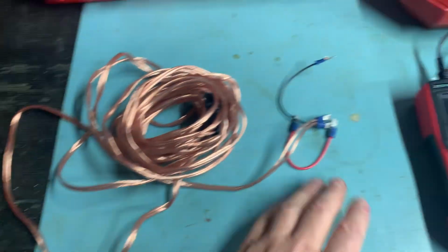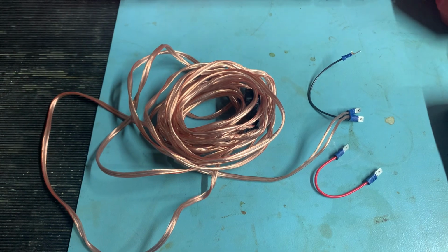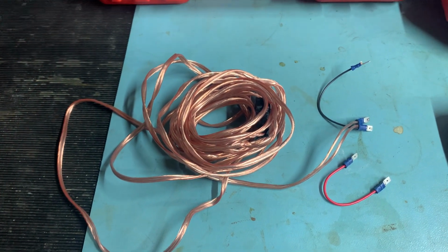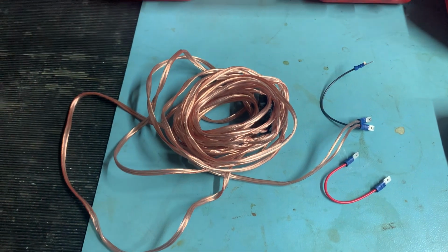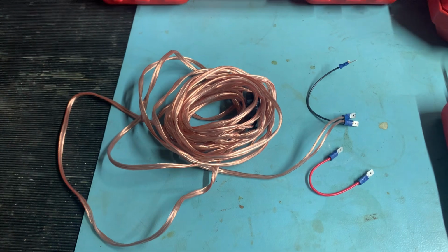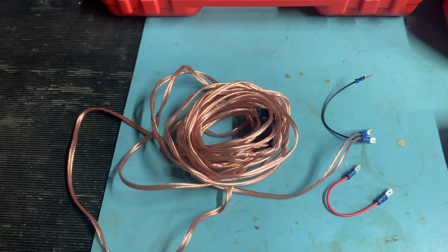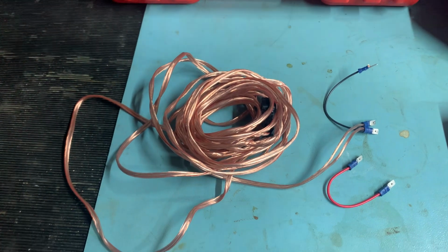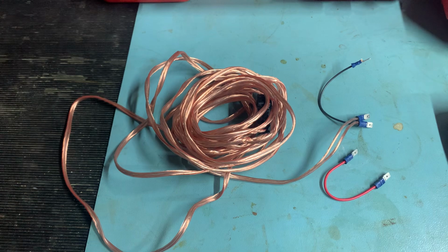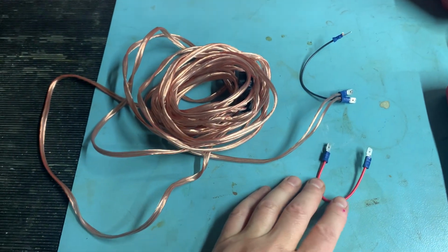Next up is when you're trying to do fuel pressure testing, you need to force the fuel pump to come on. So on a Delorean there's something called the RPM relay, and this is just a relay that sees that you're getting an ignition signal to prove that the engine's running, and it keeps the fuel pump running. When you want to test the fuel pressures, you need to bypass that relay so it's always running. So you just use a crimped wire.